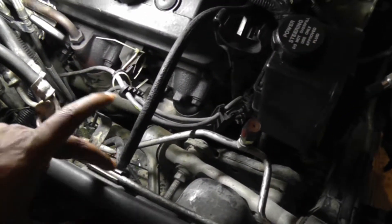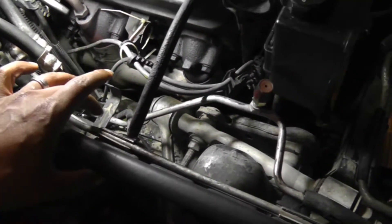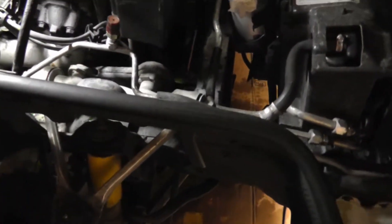I'm going to take off the bolts in the fender — the inner fender has screws right here and right here that hold on these two hose mounts. Once I take those two off I can take these hoses off. My car — I paid twenty-five hundred dollars for this C4 — it runs fine, had a water leak: the water pump gasket leaked and the intake gasket leaked, I replaced all of that. For $2,500 you get this kind of thing: inner fender missing screws from repeatedly being taken apart, but it's something you can deal with.